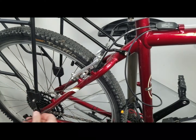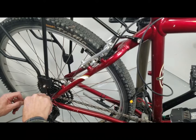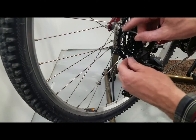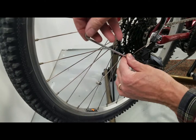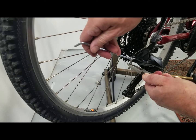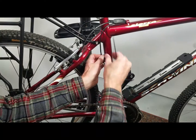Here's the other section of cable — twist it up nice and tight again. This is going to route on the outside of my rack through the alignment opening, and from there we're going to reattach it onto the derailleur. Our cable's coming down — let's loosen this up a little bit. Right before you tighten it down, you want to pull on it just ever so slightly to take the tension out. Not pulling real hard, just enough to pull the slack out of that cable.